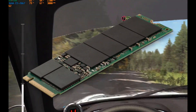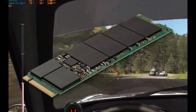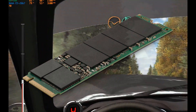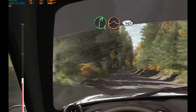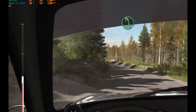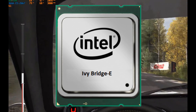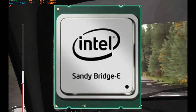NVMe storage isn't something that will ever happen on my board, or any other official ones for that matter. There's no M.2 slots, and while Chinese boards solve this shortcoming, it's not possible on official boards without maybe a BIOS mod. PCI Express is backward compatible, though I don't think you'll be using a card intended for PCIe 4.0. Another thing is CPUs on this platform are anything but efficient. While V2 Ivy Bridge chips are based on a slightly more efficient 22nm architecture, my board specifically only supports the earlier 32nm Sandy Bridge ones.